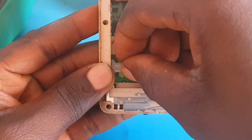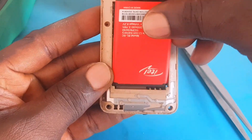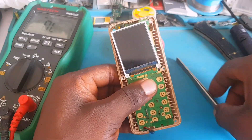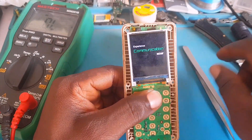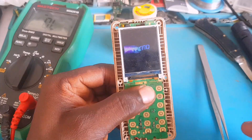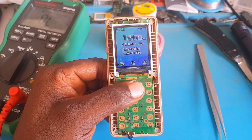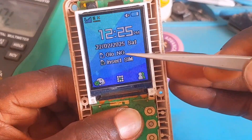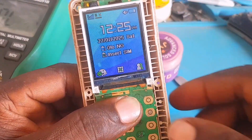It is always important, whether it affects the network or not, to replace that capacitor with one of the same size and same capacitance. Powering on the phone with the SIM card inserted — the network is searching right there, and we can see the network came out fine. This is a proper way to troubleshoot a dead phone step by step. See you in my next video — peace!